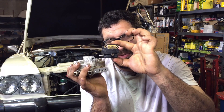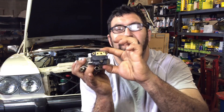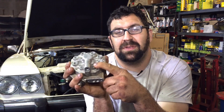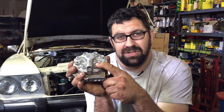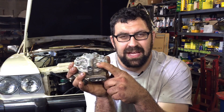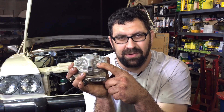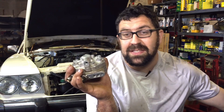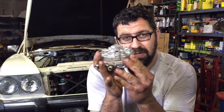If you change it, chances are the car will go right back to normal. One of the ways you can determine if this thing has failed is you can crack one or two of the lines that go in the top of the fuel distributor and try cranking the car over. If it dumps some of the excess pressure and the car is then able to start, you know that this is your problem. So let's put this aside and go to fuel distributor issues.